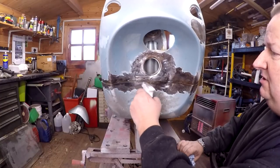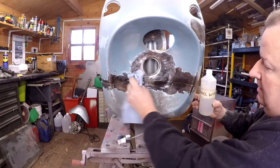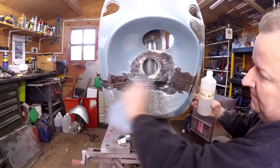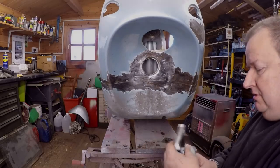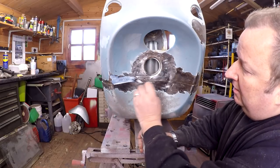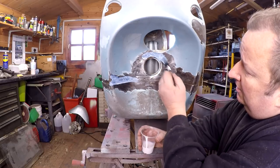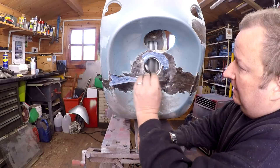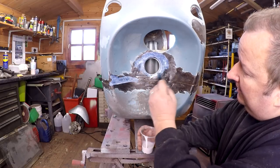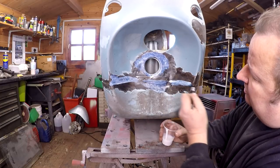So we've ground everything out now. I'm just going to give this a clean over with some panel wipe. All these areas have been dug out — as you can see we've got the bare rust there, right into the angle cracks. All I'm basically doing is cleaning the surface and preparing it for the Vactan treatment, which is a rust converter. I'm getting it well into that joint and painting all this bare metal that was rusted or showed signs of surface corrosion. I'll coat it all up and this will chemically convert the rust so it doesn't come back. We can then go over the top with a slight skim of body filler, sand it and prep it for paint.